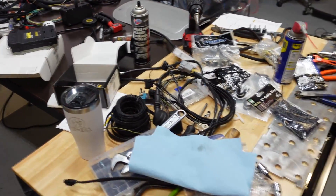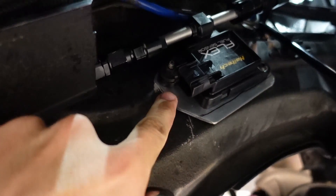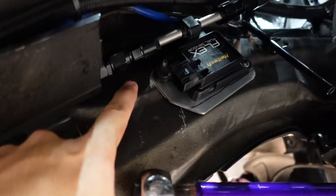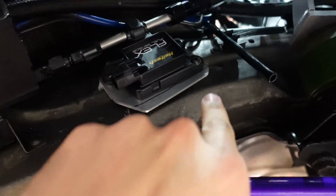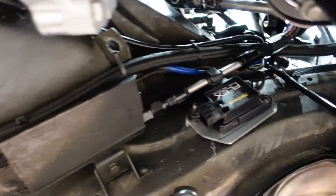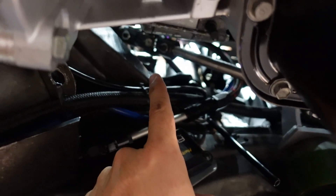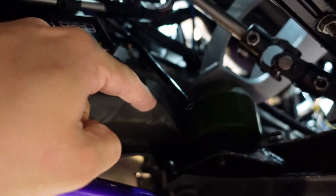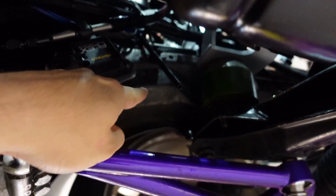I'm making a plate to mount the flex fuel sensor since it has three bolts and it's really hard to find a flat surface on the BMW. Underneath the car I mounted the flex fuel sensor using a custom aluminum plate I made, since the chassis has multiple steps. I made a flat surface for the sensor to mount to, using a stud and rivet nuts. The AN6 line comes this way, shielded with a nice stock plate, and then routes up to the regulator. There's also a drain fitting from my old catch can with a petcock valve so I can drain the car without making a mess.